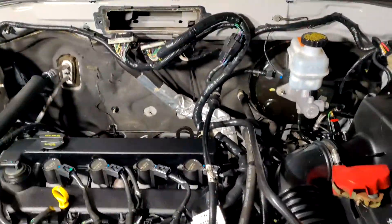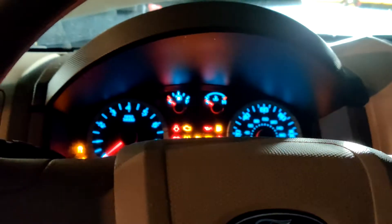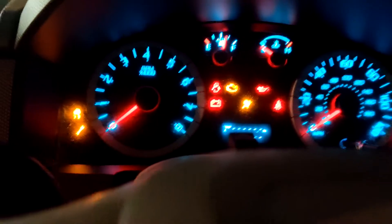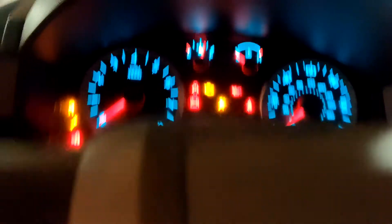I'm going to keep on tearing this car apart. Now I'm going to verify that the 12-volt system works fine with the ECU fully out — not just unplugged. Stereo works, it all works. Check engine light is on and the battery is definitely dead, but everything else works good. That is a good sign.